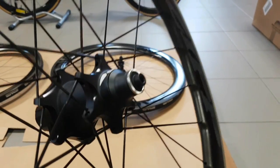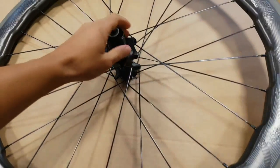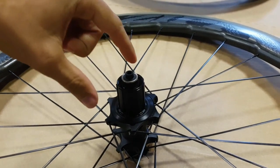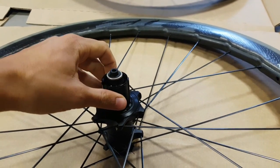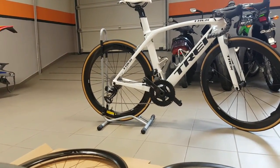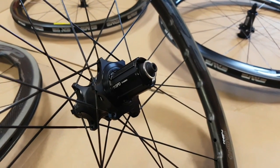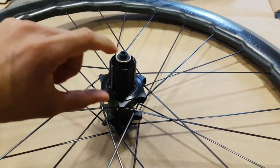The Zipp hub flanges are also quite large in diameter, and the Zipps use the Cognition freehub design — a magnet in the ratchet mechanism helps disengage it, giving some free speed when coasting compared to a standard ratchet with less friction. This is apparent when you spin the wheel on the bike stand. I have a full Ceramic Speed setup on there, and the standard freehub turns the crank slowly through the chain because friction is so low — but with the NSW, the friction in the freehub itself is so low it doesn't. Quite noticeable when riding in a bunch and definitely a good thing to have.